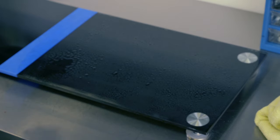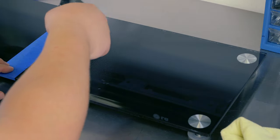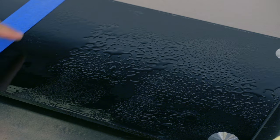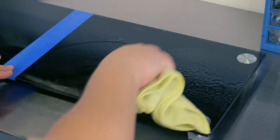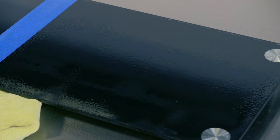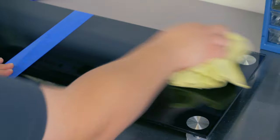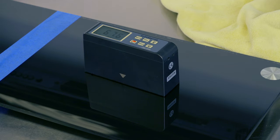We're starting to see a little breakdown — there's a puddle over here and it seems to be slowly but surely wiping up. Guys, this is still very impressive. You can tell much more of it has failed where there's really no more surface tension, but you still see there are areas that are working. I'm reasonably impressed — I would say this is fairly resistive to ISO, so I would not expect that just by giving your car an isopropyl bath you could say you've decontaminated it and stripped it of the wax. You can see it's totally failed now, with maybe little tiny pockets of product left — that was quite a few soakings in isopropyl.